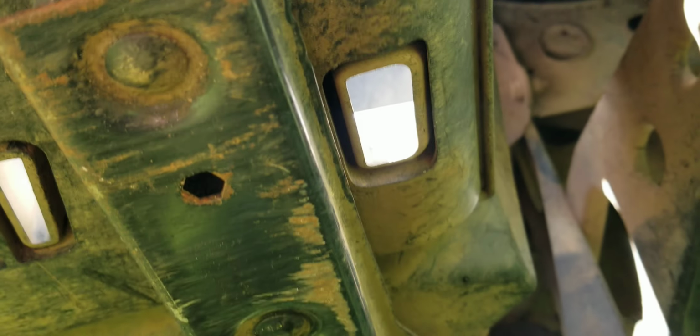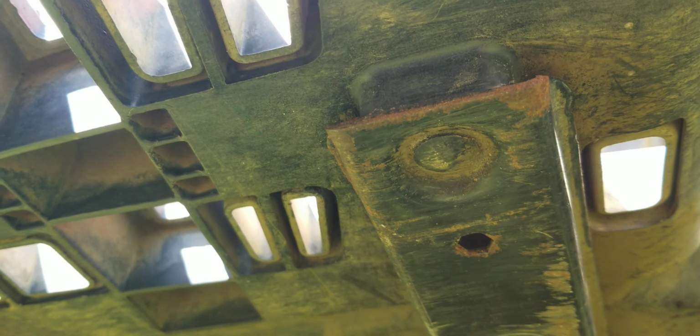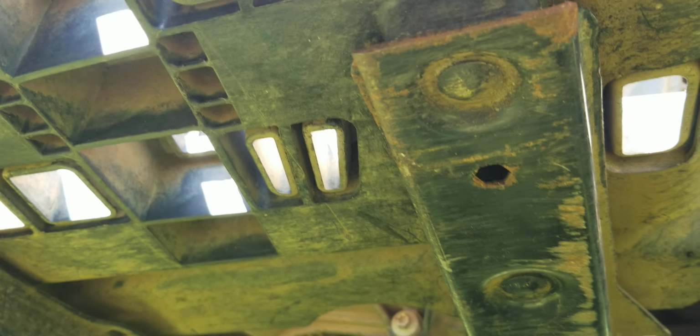So now on this past weekend, we went out and we bumped a few rocks. I have no skid plates, but you know, they're designed well. And I got a few spots where I've put a little bit of fresh scratches on here. You can see I've got a little tiny bit of rust. Now I do ride this ATV in the winter, and it might experience a little bit of salt in the winter, and I'm super careful to hit that with a bit of rust check. It's the red rust check, and give her a little coat anywhere that you've scraped some paint off. Or you can do what some guys do and sand it down and paint it, but you can easily make it last 15 years if you look after it. A little bit of rust check here and there.